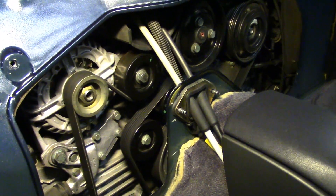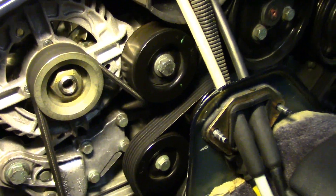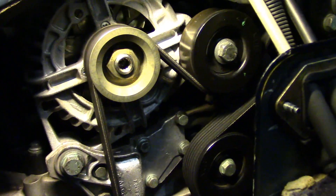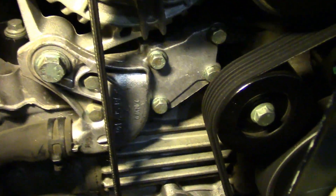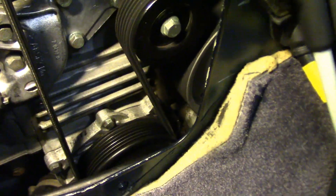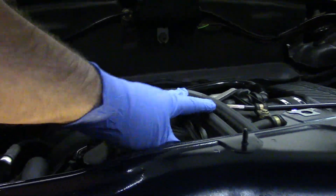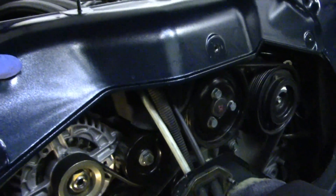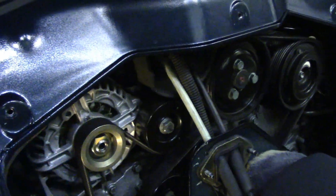So with that inner access service cover removed, the main DIY maintenance items that most people are going to be doing here — obviously one is replacing the serpentine auxiliary drive belt. You would do that through here. I've had to replace the alternator once already in this vehicle, and that was very easy to access through this port. And then down at the bottom there's our water pump — I'm going to have a video on that coming up shortly. As you can see, there's still quite a bit of access room and you can even reach the top of the engine components between the roll bar cage and the body. So hopefully that demonstrated how you put a 986 into service mode and will help you out when you're doing maintenance on your own 986. Thanks for watching folks — we'll see you next time when we get to the water pump.